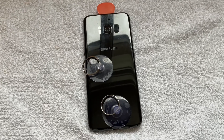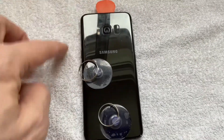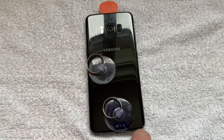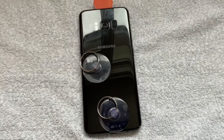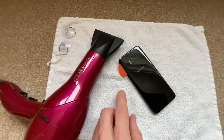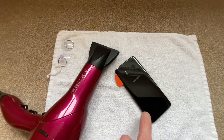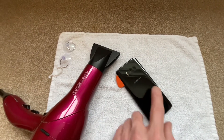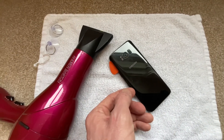Good news — after leaving it on there at 80 degrees for about five minutes, I was actually able to get the guitar pick in. I started on this side, as you can see, so I was able to lift it enough just to get the pick in, and then I've basically just been sliding it around continuously to try and cut through the glue. Using my trusty hair dryer I was able to keep heating this as I ran the pick around the edge of the phone until I was able to lift it up. There's more glue on the top and the bottom you just need to watch out for.